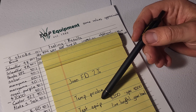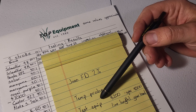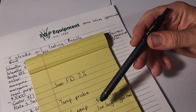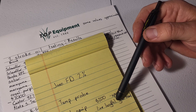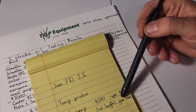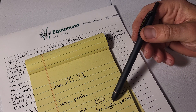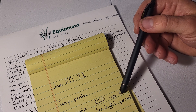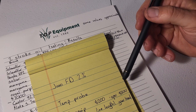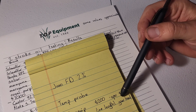Someone said the test equipment was junk — it's an Echo SRM 225 that was a junk pile resurrection, so I won't argue that. However, it's doing 8,200 RPM at full throttle; spec is about 8,500. It's running longer line length than the factory guard would allow, and it's got a gear head from something else — two things that majorly contribute to top RPM on a string trimmer. Throw an extra three inches of line on each side and you'll watch the number absolutely plummet. That's why running without a guard is somewhat foolish — you're taking yourself out of the usable power area.